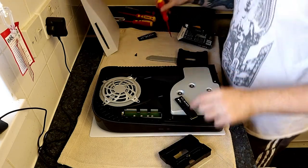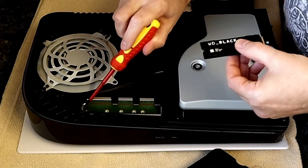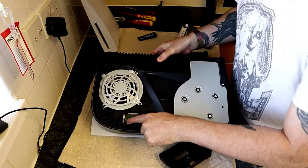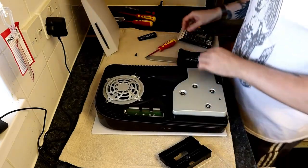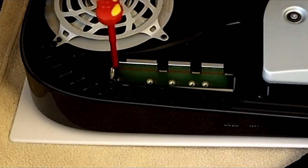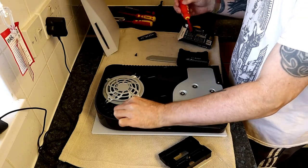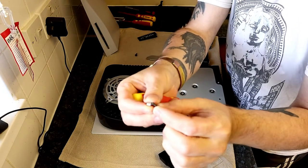There's a screw stored at the top — you can see I'm pointing at it with the screwdriver. You take that screw out along with the little spacer washer. We're going to put it in that first available hole just underneath where I'm unscrewing that screw. Different sized game drives will be situated with different holes available there inside the PS5.